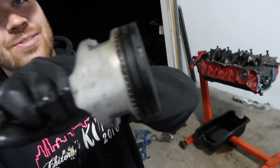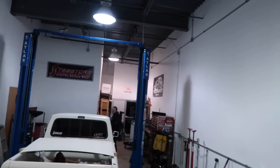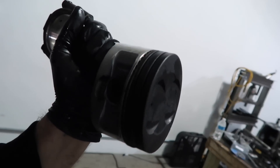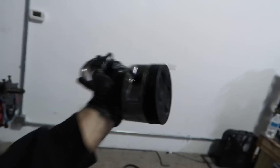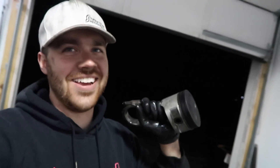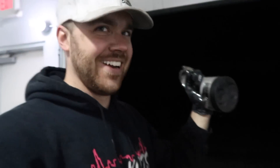Alright guys, great news. There's two rings missing on cylinder one. This is how I took it out of the motor. I caught it — I didn't know. The carbon buildup in the ring slot, all the way to the oil ring, all carbon. That is not any kind of high temp coating, ladies and gentlemen — that is the Z. Two piston rings missing. I love this. This is what we live for. I hope there's none other missing, but that is a first. Good times. I'm glad we get to laugh at the owner's expense — sorry, Johnny — but that's a good one.